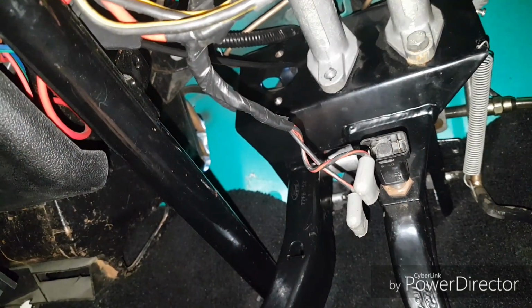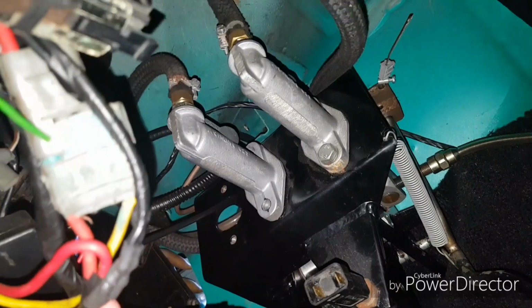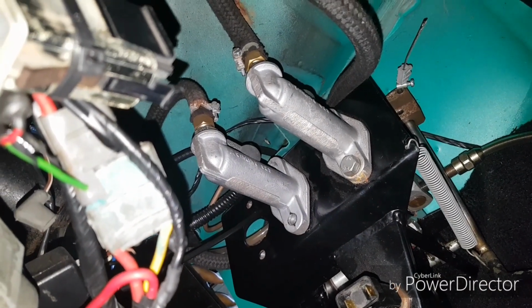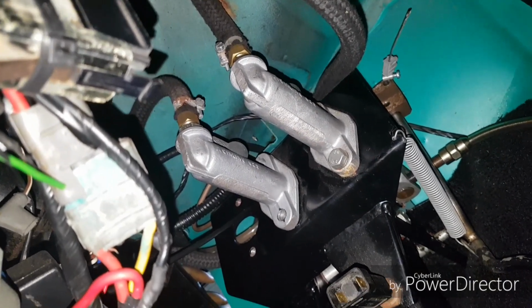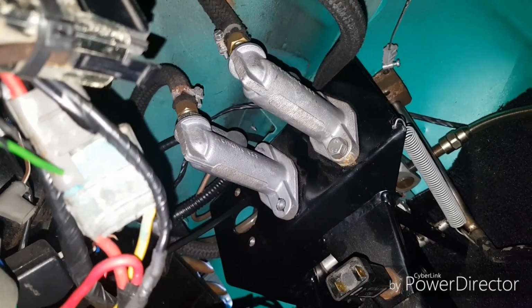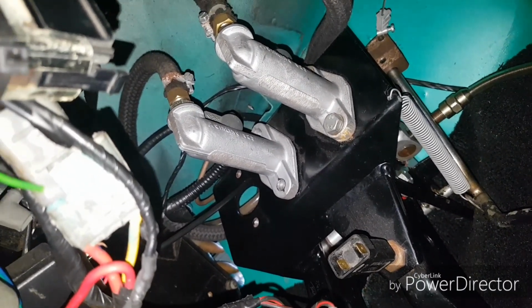holds a little ring tag, which is on the end of the clutch cable. So that's got to come off, and then I don't know if you can see at the top here, I think I'm just going to clamp that and clamp that one as well for the rear brakes, undo them as best as I can. And then you see just about halfway along this at the top, that's where a hard line is. If they were flexible, we could have moved this around, but it's not.